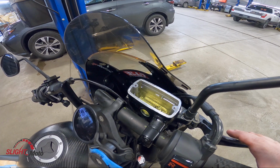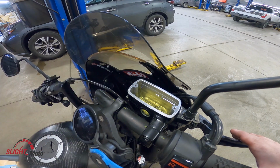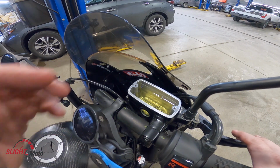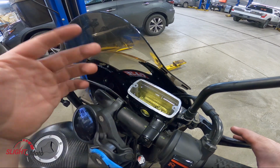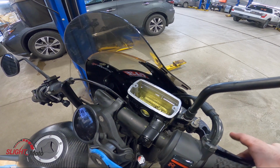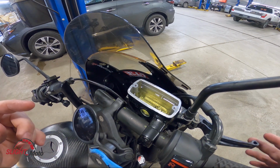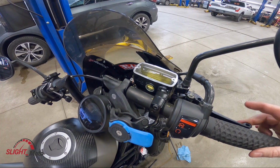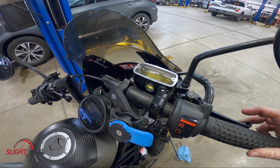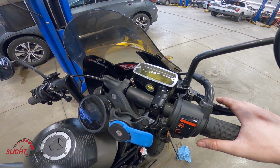Now, I do have a video on how to bleed the system. I'm gonna link that in the description, but basically, whenever you take a line off, you're gonna have a lot of air in the system, so you're gonna end up bleeding it the way you normally would. The only issue that you're gonna have is there is still gonna be small little air bubbles inside. So once you get a little bit of pressure here, but it's still spongy, the trick to this stuff is all you're gonna do is the brake lever you're gonna actually have down, and you're just gonna zip tie it. What that does is it actually helps all the small little bubbles kind of come up through the actual master itself, and then you would try it again. Or if you have a spongy front brake still, then you would just bleed it again.